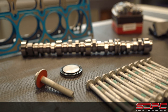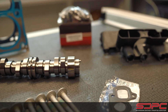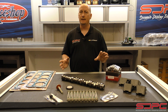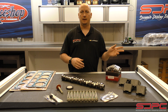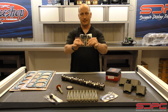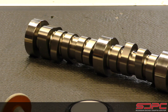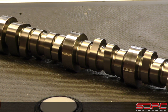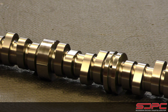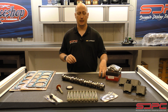If you're looking for an AFM repair kit for 2019 and up vehicles with dynamic fuel management, you're going to have a few different parts. We don't have a kit set up on the website just yet — maybe at some point in the future. That will require, instead of just eight lifters, 16, because it's able to shut off all the cylinders. The camshaft is optional in that dropdown. You'll also notice on our website that we have the VLOM as an option, as well as the high pressure fuel lines. Same goes for those lifters I mentioned.